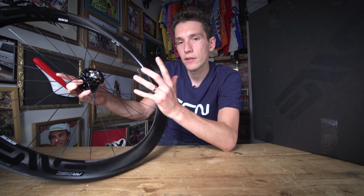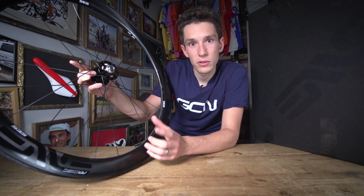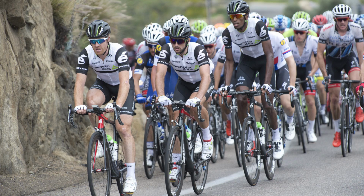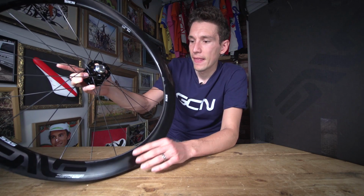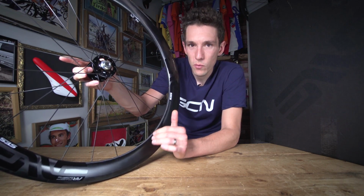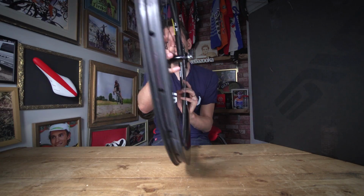The reason ENVE created these wheels was because they realised that when the team that they sponsor in the World Tour, Dimension Data, were running 28C tyres, they weren't getting all the aero benefits from their normal wheels. So you see, despite having a super aero rim, if the width of the tyre isn't correct, you don't get all the benefits. So what did ENVE do? They created this, a much wider wheel.